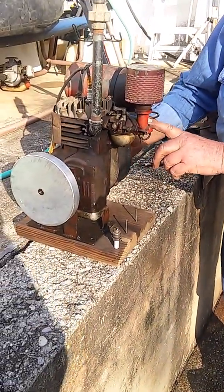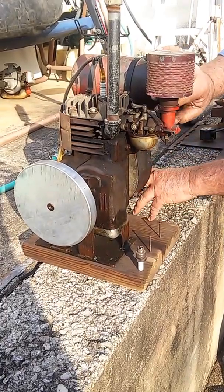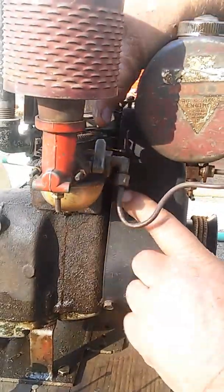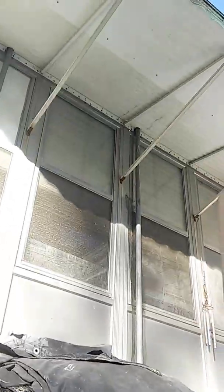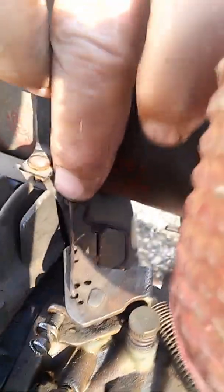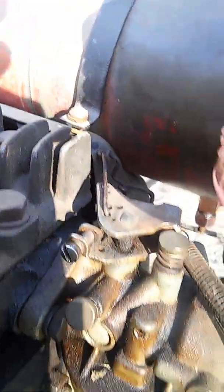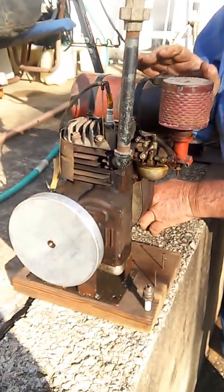I've been tipping it so it might be flooded — the float don't work right when it's tipped sideways. I made governor linkage for it, made an air vane governor in there — a governor flapper out of a piece of aluminum siding. There's a flapper in there like the old school. I made my bell crank out of coat hanger wire. You can see it down here moving; the linkage is hooked to the top, to the carburetor, and the underside goes to the butterfly. It truly would govern if I needed it to, but just for showing and playing with, it don't have to.